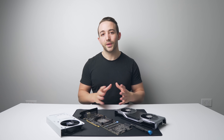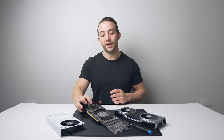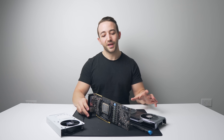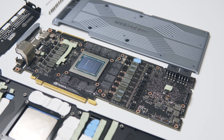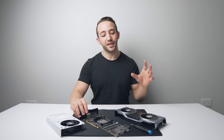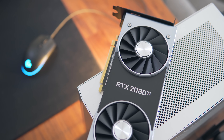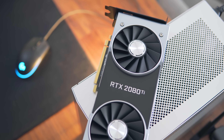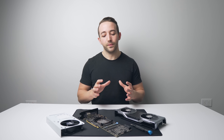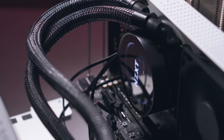Before you go and buy a Kraken G12 hybrid kit for the 2080 Ti, there is one more important thing to consider. By stripping the 2080 Ti down to the bare PCB and also reducing the fan noise considerably, you do hear a lot more electrical noise and coil whine from the GPU. Complain all you want about the heavy, dense, over-engineered Founders Edition cooler of the RTX 2080 series, but it really does a good job of blocking coil whine — with the stock cooler I didn't even notice it at all, whereas after putting the Kraken G12 on it was quite noticeable. Here's an idea of what that sounds like.